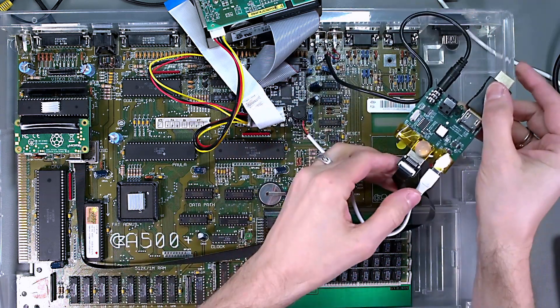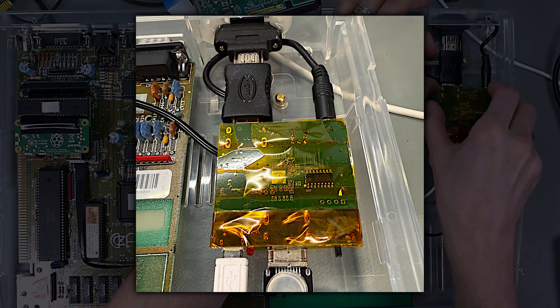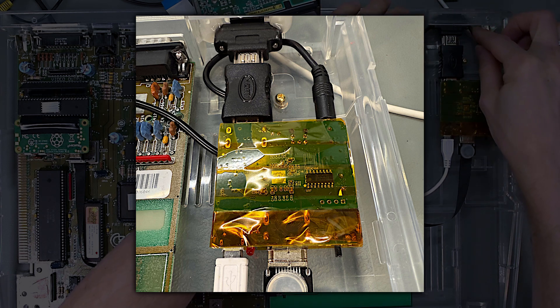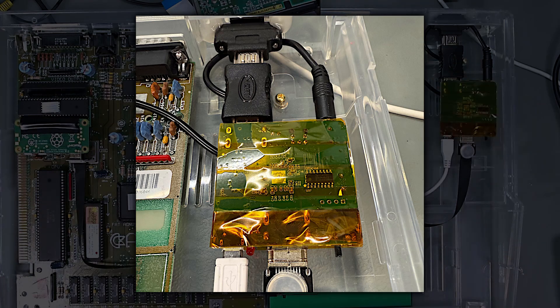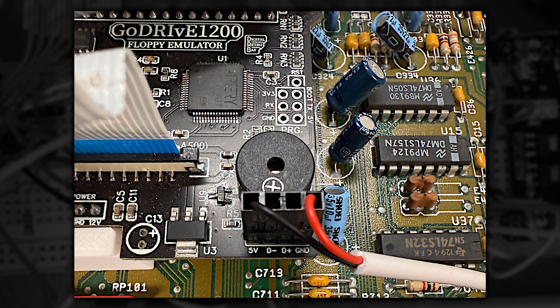And with the right combination of HDMI adapters it's easy to connect up. The unit generates a small amount of heat so I've covered one side with Kapton tape, although it's probably not really necessary. It's held in place by being connected to the HDMI port I've put on the back of the machine. With the right weird combination of connectors and adapters I was able to neatly connect it up to the HDMI signal. As for the audio input, the simplest solution was to get a headphone extension cable, cut one end off and solder it onto the internal audio connectors. The ground connection took a while — it needs quite a bit of heat — but it made for a very clean solution. The last issue is the 5 volts needed. There's 5 volts available in several places throughout the board. As I have the GoDrive installed, I noticed a pin header that had 5 volts on it, so I decided to repurpose it by cutting off the end of a USB cable, adding a connector and plugging it in.